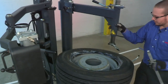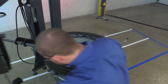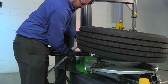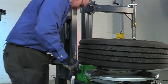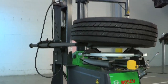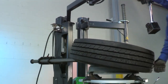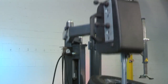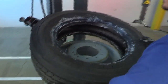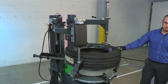For the lower bead we're going to use the roller, drop the roller all the way down and up against the rim. Raise the roller until you can see it pop out from the rim and simply roll the tire off. Tire is now removed from the rim.